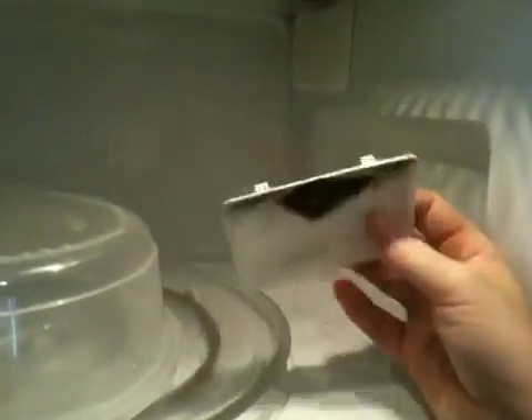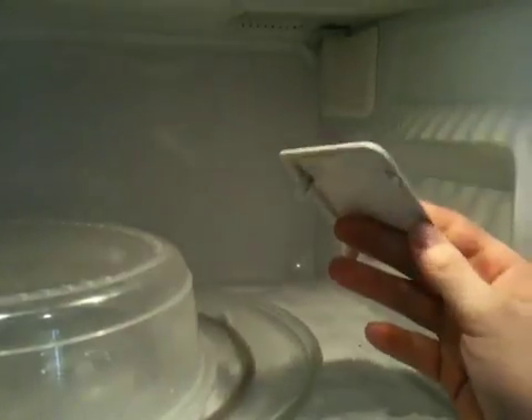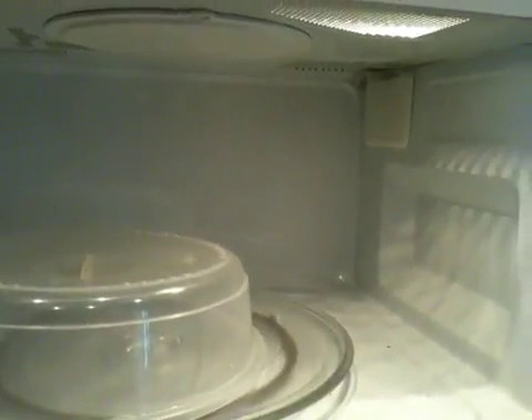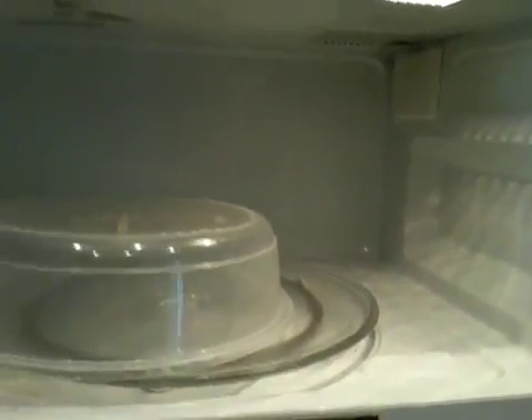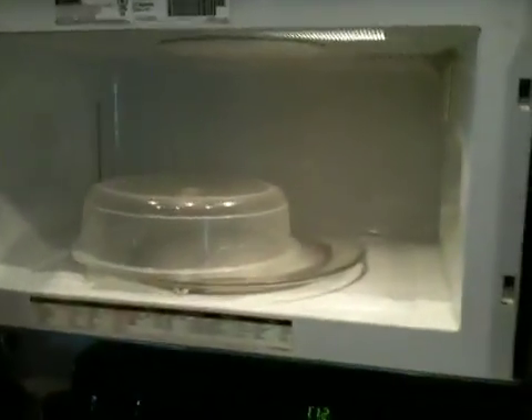I don't know what this is made out of — it's not just plastic, there's layers of something inside of this. Maybe someone who actually understands microwaves could tell you, but from a country boy standpoint: pop this off, test the microwave, see if it still sparks. If it doesn't spark anymore, just replace this one piece. Just go to the website, look at the diagrams and replace the part. I hope this helps you out because I pulled the whole thing out and tested stuff and that was just ridiculous when all I had to do was pop the part out and $4 later my microwave works again.